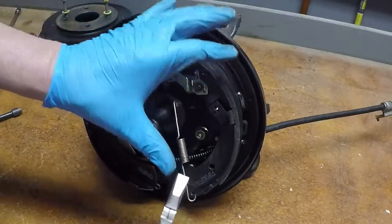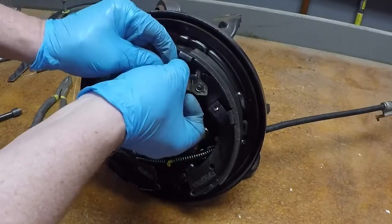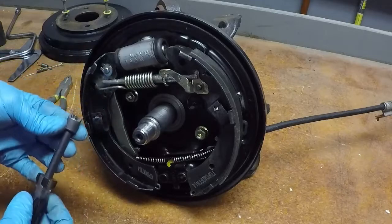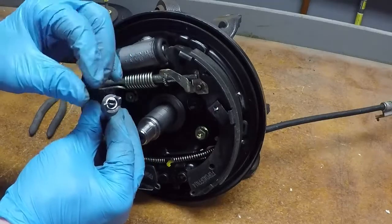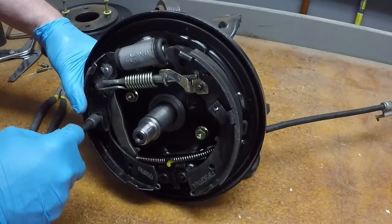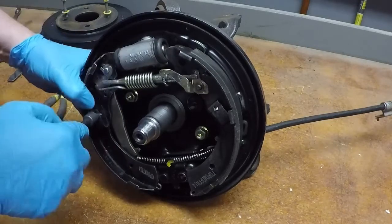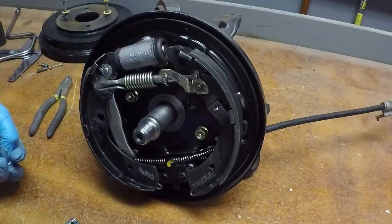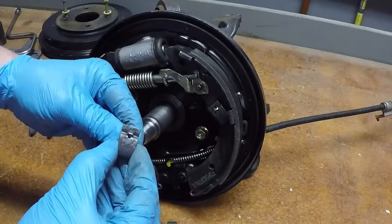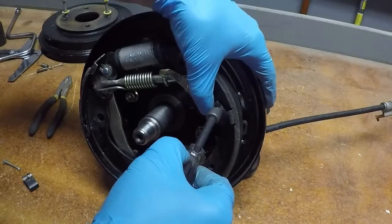Squeeze and then use your thumb to push and pull while holding with the other hand. Here is the hold-down spring tool for a Honda — it has a little wedge that floats with a notch in the center that grabs our hold-down nail. Line it up, hold from the back side so the center won't get pushed backwards, then rotate 90 degrees. The wedge comes straight through and turns, sitting at an angle. That's all we're doing — just turning it 90 degrees and pulling it off.